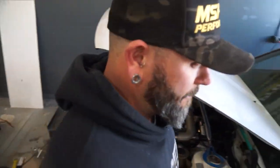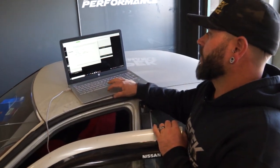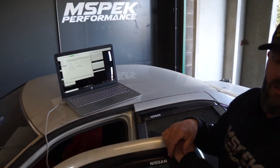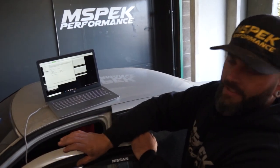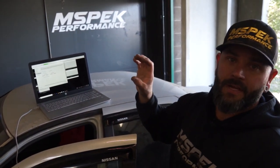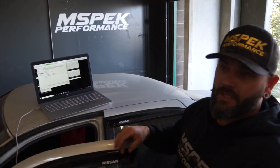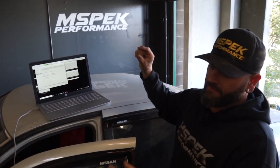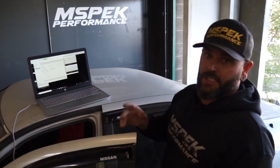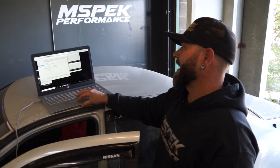After I set the timing, I'll rev through a little bit and make sure that we don't have a massive amount of timing drift as we rev through the RPM range. You don't typically see it with hall effect sensors. This is an optical sensor — Nissan classifies it as a hall effect but it's actually optical. With Nissans, you won't really see too much timing drift because you don't have a reference between crankshaft and cam. On a 2JZ or most other motors, they have a crankshaft sensor and a cam sensor in two separate spots — crank down on the crankshaft and cams up top. As your timing belt runs through and you get timing belt stretch or deflection, revving through the range, you might actually see a little bit of timing drift, and we can go in and account for that if it's there.